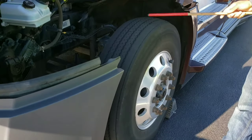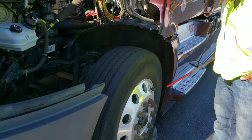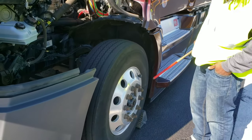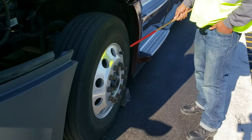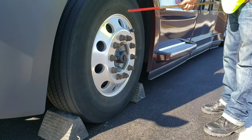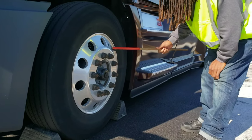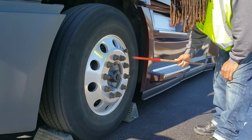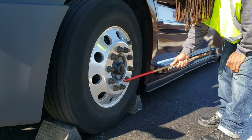My tire is properly mounted and secured. On the tread and sidewalls, no abrasions, bulges, or cuts. The tread is no less than 4/32nds of an inch, and it's filled to manufacturer specifications when checked with an air gauge. My rim is properly mounted and secured, not cracked, bent, or broken, and there are no unauthorized welds or holes. My lug nuts are properly mounted and secured, not cracked, bent, or broken, none are missing, there's no powder residue or rust trails, and no cracks around the bolt holes.